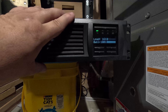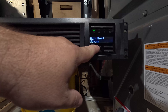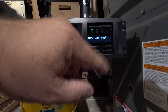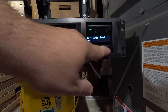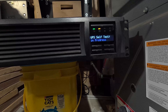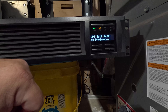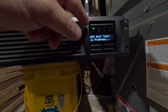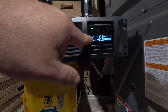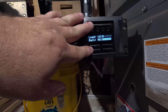Okay, so we're at 100 percent. I put the front cover back on. Let's go ahead and do a self test — configuration test — UPS self test, change it to yes, click. It's firing off, it's running on batteries only. Takes about 5 to 10 seconds or so, then switches back over to AC power, and it passed.